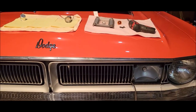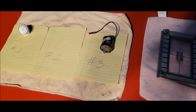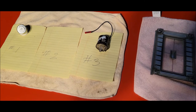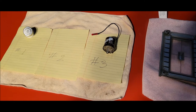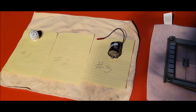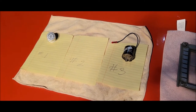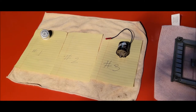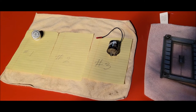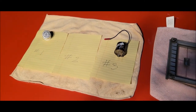Let's try number three flasher with that ground pigtail and see if that changes anything. With the number three flasher in the four-way socket with the pigtail grounded, the four-ways do not even light up or turn on. So as far as the four-ways go, I cannot use the number three flasher, but it likes the number two flasher — everything works, tail lights work independently and all that. I'm not sure if the turn signal flasher will have a different result with the pigtail flasher. The pigtail does not work at all in the four-ways, so I'm thinking it probably won't work on the turn signal either.